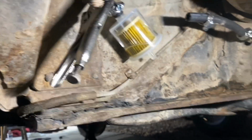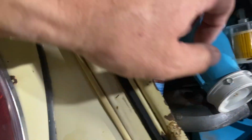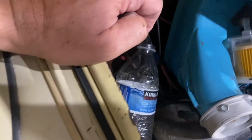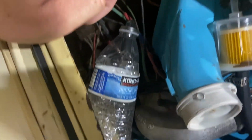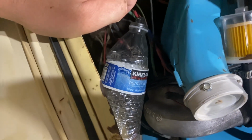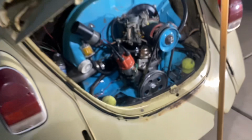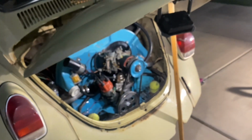through this line. So I'm going to air up the air compressor. We are going to force feed down the line that goes down the chassis. I've disconnected our fuel filter, which also has some sediment in it, which makes me think there's probably some crap in that line. So we're gonna blow it in to this and hopefully have nice, fresh, clean lines, and then our pump should work. So that's the plan.